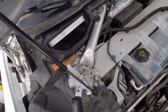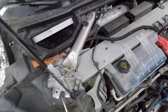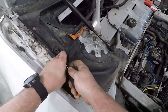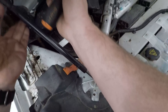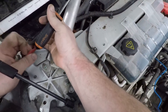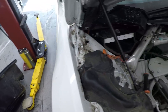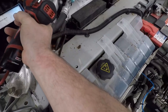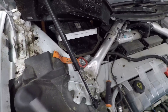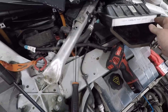Next we're going to remove the microfilter housing — look at those clips. Lift that up. The reason we do this is because we need to get to this fireman's loop. Let's get the loop down here. Pull out the housing. Now we can get to the loop.